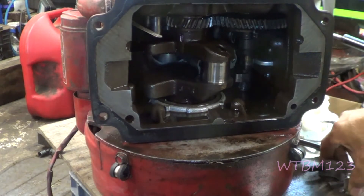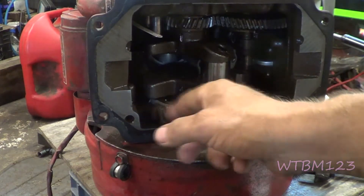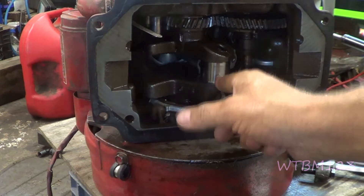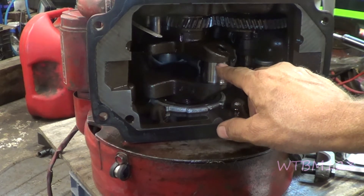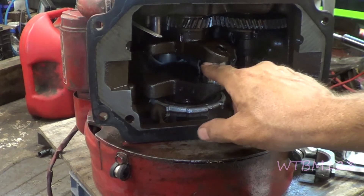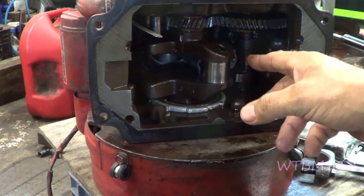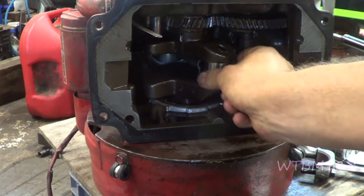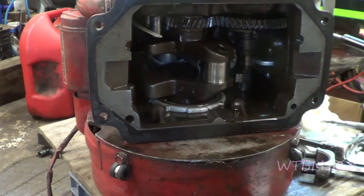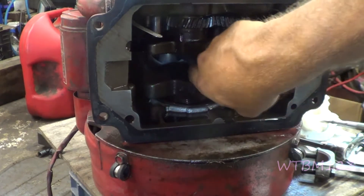I plastic gauged it and it said it was right on the outer limits. I tried it and it knocked - sounds great when it gets warm, but after you've been mowing for half an hour it starts getting a slight knock. I can feel a little bit of scratchiness with my fingernail, which is not good. But let's measure it and get all the oil off this and the micrometers.